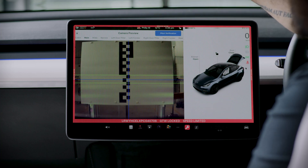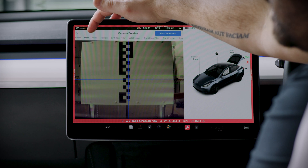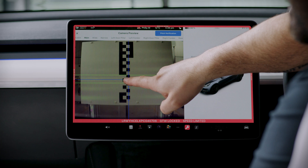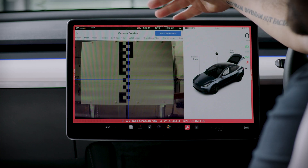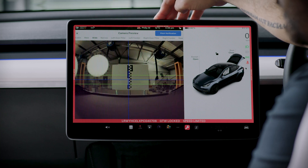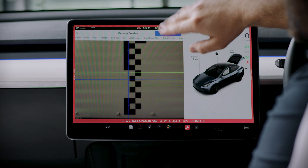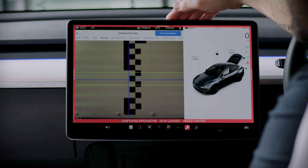It will load up and you'll see the display showing where the camera looks on the board. This car is a DAS 3.0 so it has three cameras at the front: main, wide and narrow. On the main camera, the blue line should ideally be at the top of the square, and here it's within the two green lines so it is within tolerance. We do the same check on the wide camera — looks good — and finally the narrow camera, which is good too. You can even see the slight variation between cameras in the single frame mount.